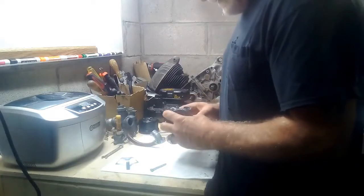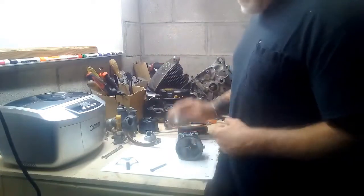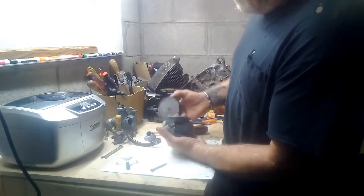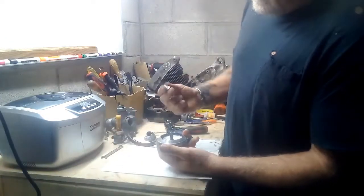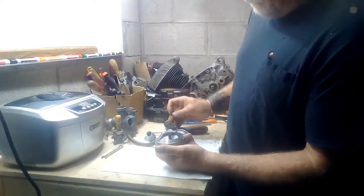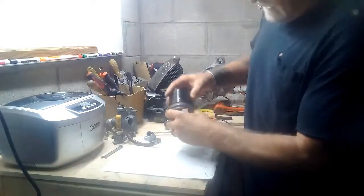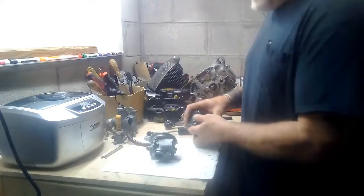For the most part it is back together now except for putting the manifold on and putting the spark arrester back on. The spark arrester just goes on here — boom — this cover goes over the top of it. Put your screw down through the cover, down through the holes, onto the carburetor, push it all down on there, and tighten up the screw. Again, no Hercules.